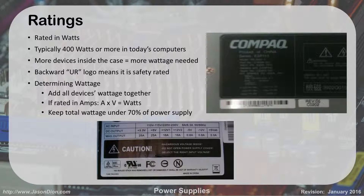These power supplies are not 100% efficient. They'll start out around 90% efficient and get weaker over time. If you start out already at maximum capacity and it degrades, it's going to fail too quickly. So around 70% usage is the rule of thumb.